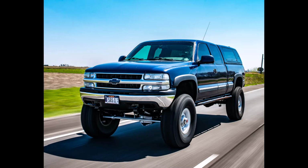But I swapped to the new body style 14 bolt because I wanted the internal e-brake. Yes, the integrated drum and hat. It works pretty well if you keep new parts in it. I just redid the drum in that style in the KJ, and it's still garbage. It needs to be adjusted better, I think. The 14 bolt parts are a little bigger than the ones in the KJ, I'm betting. Just a smidge.